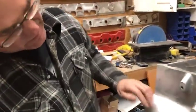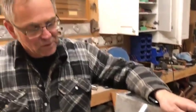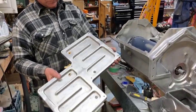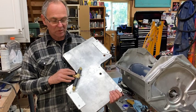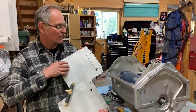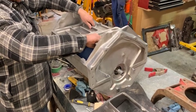I've just been thinking, seeing this as an electric motor — I was thinking I should paint this orange because it's a small block, but I could shine it up and make it like buffed aluminum, polished aluminum. That might look cool. Maybe it's a waste of time. So we're going to play around and make sure things fit here. What I got here is the heat sink for the controllers, and I had to do a bit of tapping and I'm running lines. These are going to be the cooling lines, and because this is a prototype, I've realized I need little flanges on here, so I'll actually cast them in the next one, but for now I've just bolted a piece on, and I'll probably just weld this in place.